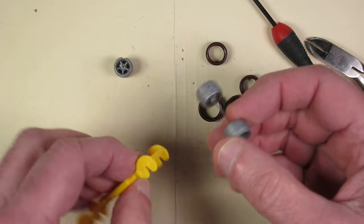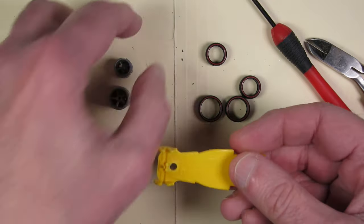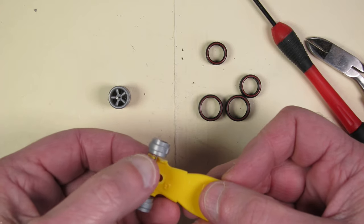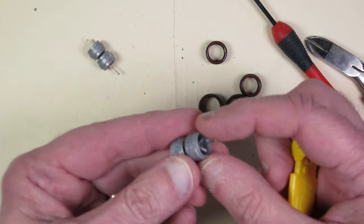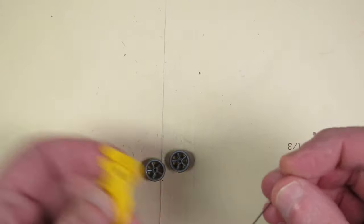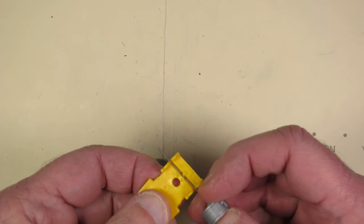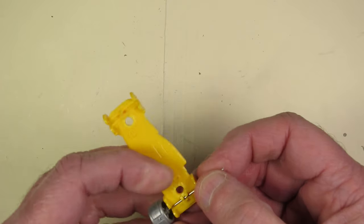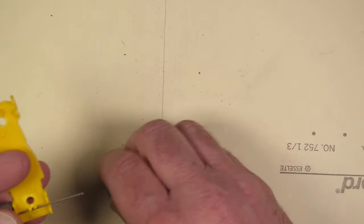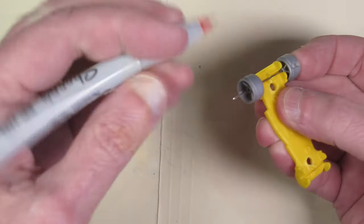So I do end up adjusting the length of these axles. And I do it using the trick with the axle tube that I've done before. I had to figure out exactly how much I wanted to cut off of these. The fronts almost didn't need to be adjusted, but if you're doing it, do it right. So I cut the end off of a much longer axle, as you see there. I cut the axles that were on there off. They weren't long enough to just do the substitution, obviously, with those axles. So I grabbed some much longer axles that I had laying around.